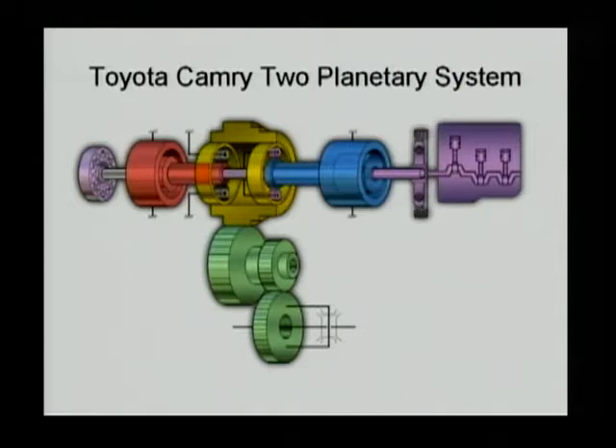With this design, it is possible to use a high-speed motor. The motor can run up to 13,000 to 15,000 RPM in this design. But in the Prius, the motor speed usually runs at a much lower 1,500 to 2,000 RPM. So this design is capable of operating at very high motor speed, but gives you the same functionality as the Prius hybrid.